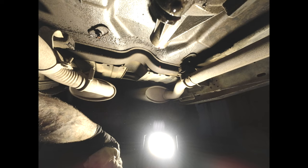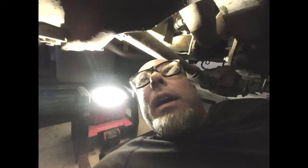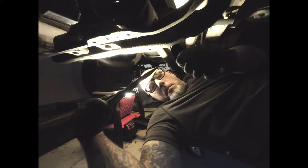Let's go. Now I'm going to be using an 8mm here. There will be a bar that comes and bolts in right here. However, at this point of the process, remove that. Now we're going to disconnect the shift linkage — you'll find that up here. We're just going to disconnect this cotter pin and pull the linkage. If you look up here in the shadows, there's the light connection for the four-wheel drive — disconnect that.